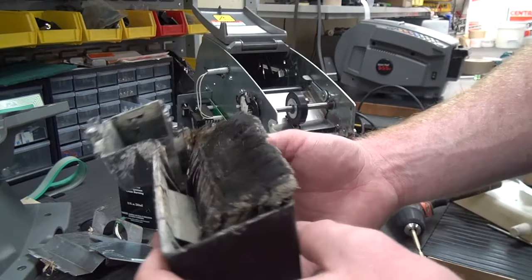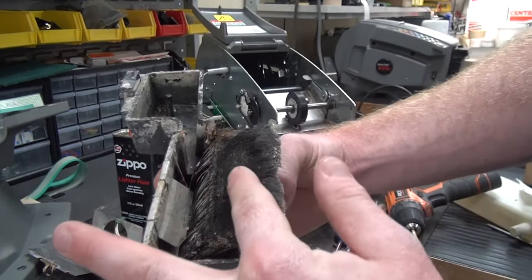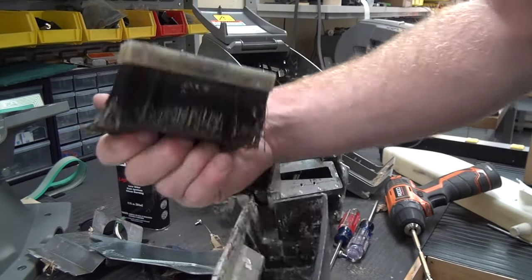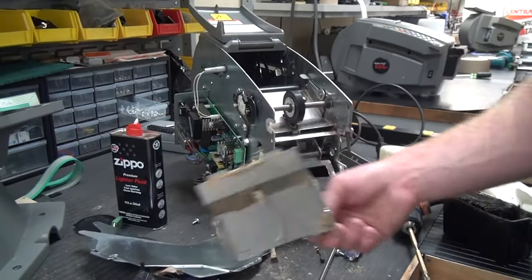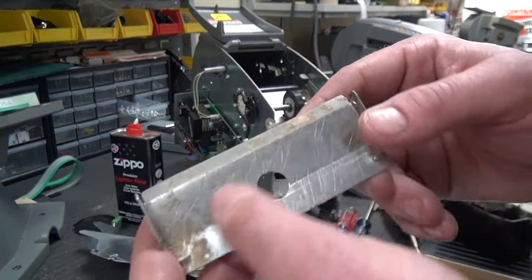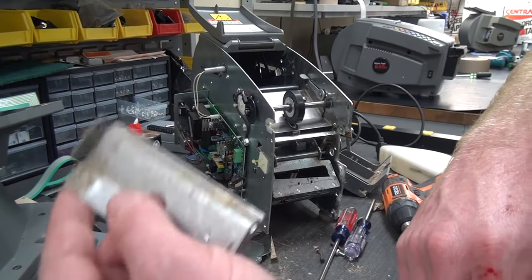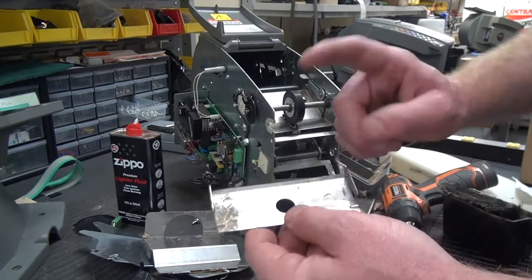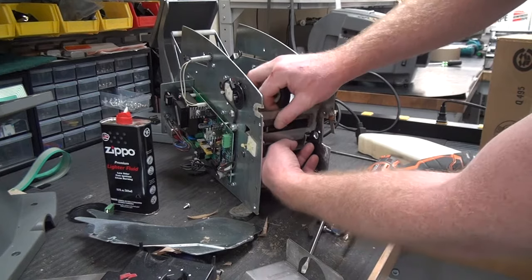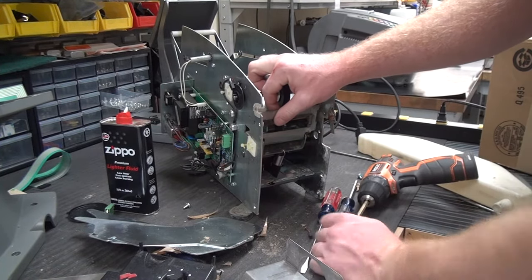Another thing we look for is to inspect the brushes. You can see there's a bit of a dip in the brushes — that's from an endless cycling of tape slowly cutting them back micrometers at a time. I see these dips a lot in machines that haven't been repaired in a while, so we'll certainly replace these. Now I'm going to clean this plate — this plate is incredibly important. All this buildup along the sides are little places where if tape hits just right it can cause a jam. Clean this little platform right here and the machine works great. One other thing I like to check is to work this yoke system back and forth — just make sure it's not too jittery. This one feels fine.